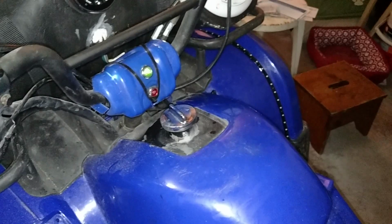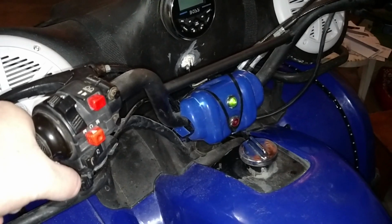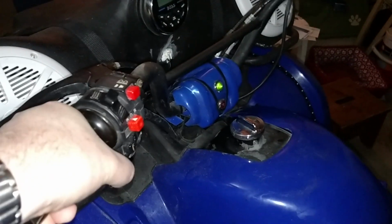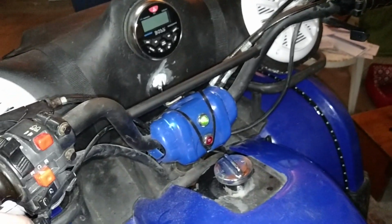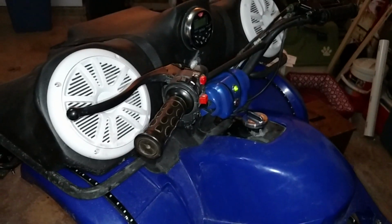Going to have to, of course, tighten everything up, put everything back on, especially this one down here sitting next to the chain. This little guy right in here needs to go back in that grommet, and the voltage regulator can't just hang like that. Probably not the best spot for it. But yeah, the simple solution may always be the easiest solution, or the best route. $20-something later, and reseat the wiring on the ignition switch. Go figure. Well, let me get it cranked up and see how it goes.